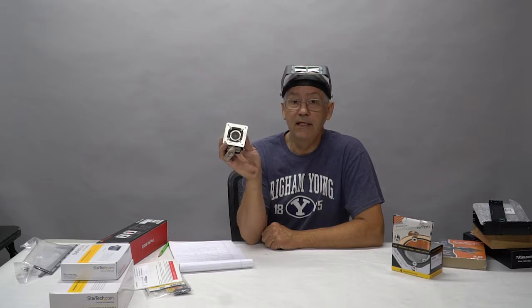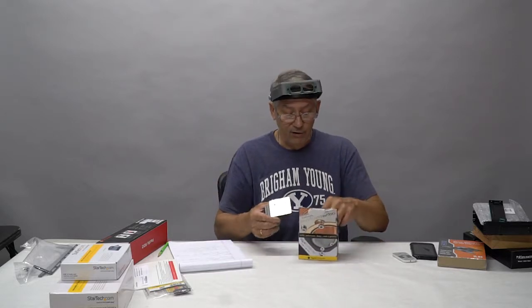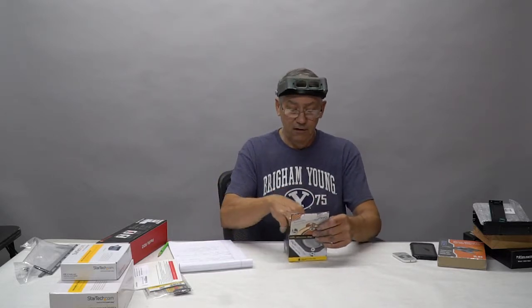So this is a way that you can, once a year, open the back of your case, look in this window and check it. Say, is it clean? Is it clear? Fine, leave it be. Has it got debris in it? Good. Open the window, take it out, turn it off, take your filter out and clean it. You're done. It's a really neat setup. You don't have to drain your loop. Normally with a filter you have to drain the loop and then remove the filter, and it's a real pain in the arse.